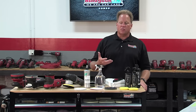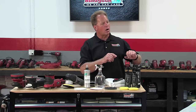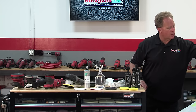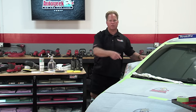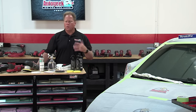So I always practiced polishing all the glass on all the cars, and one of the things I learned is if you wash the car and then polish the glass, you'll end up getting splatter around the edges of the window frame. And on the side windows, you've got that fuzzy gasket or rubber gaskets, and now you've got to clean it again. So here's what I did, back in Oregon: the first thing I would do is polish all the glass, then wash the car. And as I wash the car, I would get all the splatter out of the thing, so I don't have to repeat steps. Make sense?